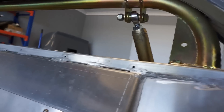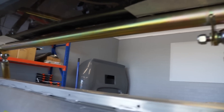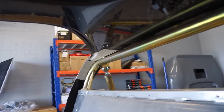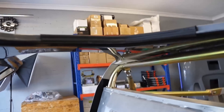Okay, so we've now done two lots of trimming and as you can see the cuts are getting pretty close to those original lines that I drew. It is starting to sit down a little bit — just for point of reference we've gone from about a 20 millimeter gap to about a 10 millimeter gap on this side. The other side hasn't dropped as much but I think I've been a bit more conservative with what I've cut out of that section.